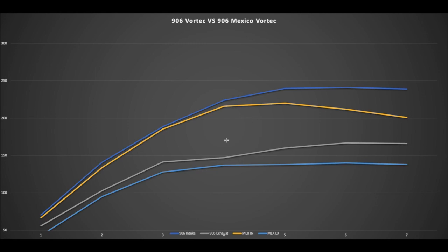Once I figured out there was a difference in flow between the 906 Vortec and the Mexican Vortec, I compared the information. If you get Mexican Vortec heads off a crate motor — which is exactly where mine came from — they'll actually say 'Made in Mexico' on them. There appear to be a few revision versions of the Vortec head, though there isn't much information out there. I found some details on one of the top porter's websites. This is not the Bowtie Vortec head, which is a separate racing-oriented casting.